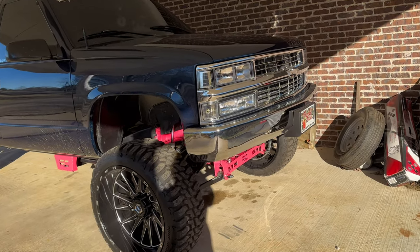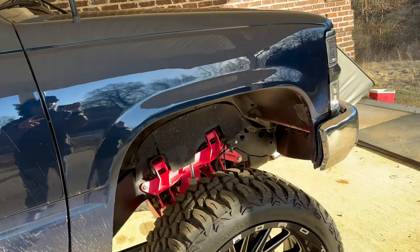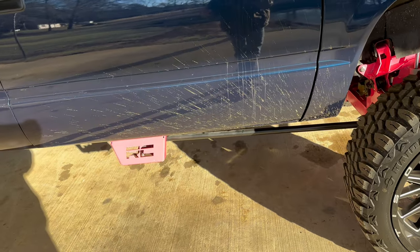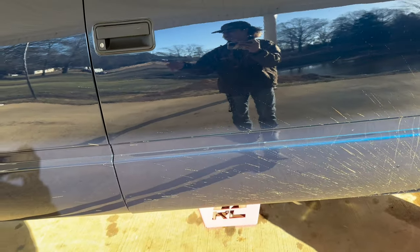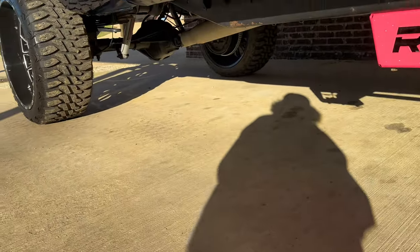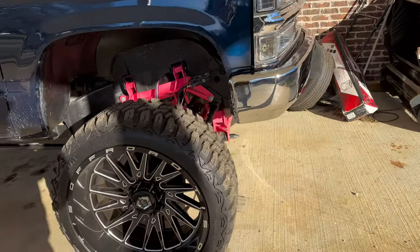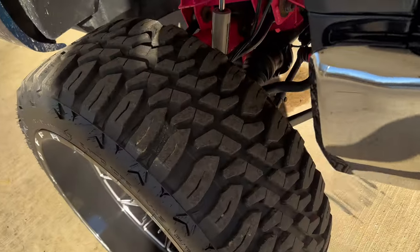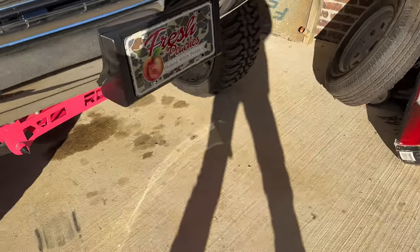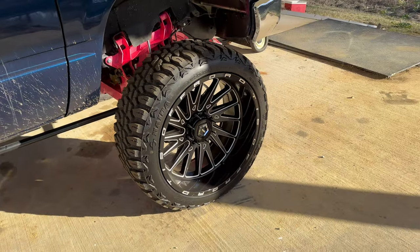When I bought this truck, it was blown up — it ran, but the motor was knocking horribly. I put a brand new motor in it about 500-ish miles ago. It had a new transmission in it when I bought it. It's got 4.18 or 4.20 gears in the rear and the front, and it's got a new rear end under there. All the front end was in absolutely horrible shape, and you can just look at it all and tell it's been replaced. I replaced all that when I put the lift on — all new shocks all around, new ball joints, control arms, literally just about everything.